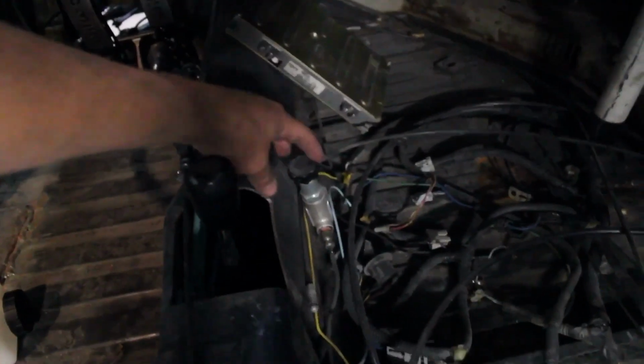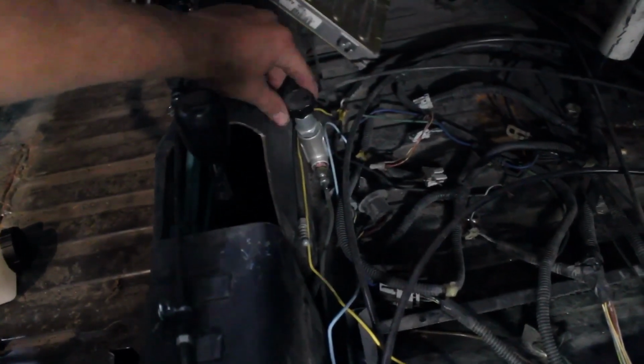One master for the clutch, and then the rear brakes are the front brakes from the GSR. So they are about twice the size of the upgraded front disc brakes on the Bug. So we don't know if that means the rear need more fluid or more pressure because they're bigger, or if they need less so they don't lock up. So just in case that bias bar isn't enough, we also put in this little, I forgot what it's called. Basically it's a knob. It's in line with the rear brake, so we can adjust pressure just up and down by moving this knob. So that's basically the setup. It's pretty simple amongst everything else we've done on here.